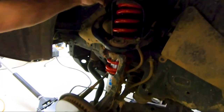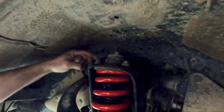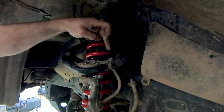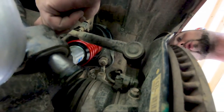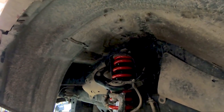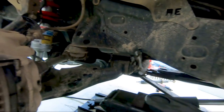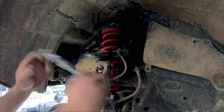Randy, give us a quick once-over of the way we did it. I know it's probably wrong for the internet experts, but tell us what we did. You drop your three upper strut mount bolts, take off your upper ball joints, remove the brackets for your brake line and ABS, remove your sway bar bolts and your lower strut bolt — and that allows everything to drop down far enough so all you have to do is lift the upper control arm and you can slide everything out. Then just slide the new one back in and bolt everything back up, versus what the instructions were telling us to do, which was take a lot more apart. We think we got it — we're going to take it for a test drive now and hope it doesn't fall to pieces.